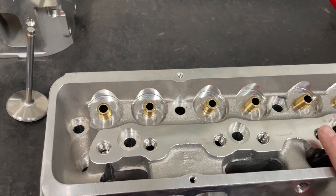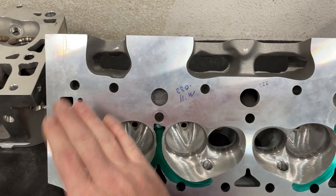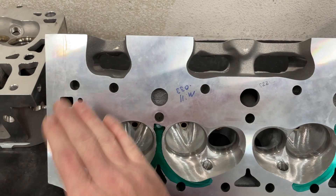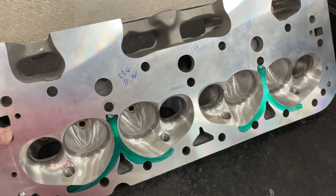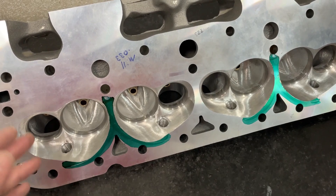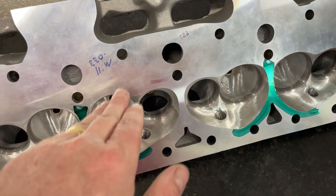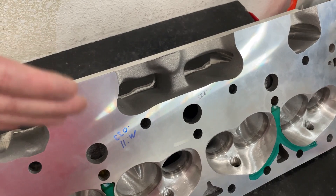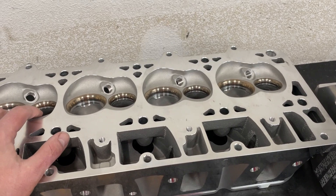Because of all those extra steps, angle milling is way more expensive. I charge $110 for flat milling a pair of heads, and I don't even angle mill myself — I send them to another shop. However, Brodix is really nice about this. On their Dragon Slayer heads, if you want a 58cc chamber, they'll angle mill the casting before they ever put seats or anything else in, then cut the seat locations, bolt holes, and intake face all correctly. They do charge more — around $350 — but you can get your chambers down properly.